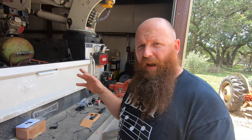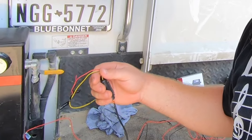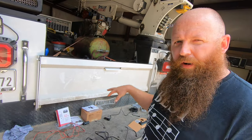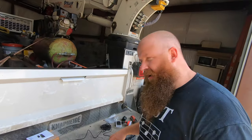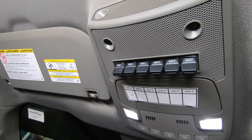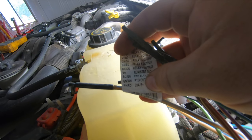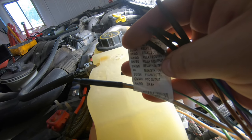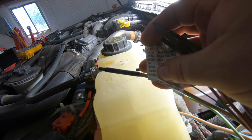If you don't have the skills or ability, it will get the job done, but it's definitely not the right way — and for sure not the best way. The third alternative is to have this thing wired with power at all times, and that's what this other section of wire does. It already comes with fuses installed and provides ground, power, and accessory. It lets the camera know whenever you want to be in parking mode via accessory power and always has available battery power so the camera can be on and recording. Ford very graciously labeled the upfitter switches for the 2019 Ford F550 — we want to use the 20-amp brown and red and the run-start brown, which are both non-switch.